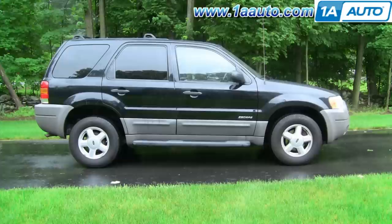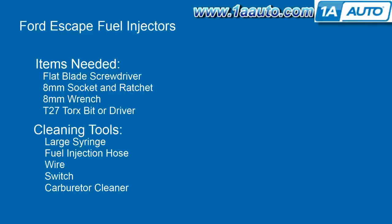Thanks. In this video, we're going to show you how to replace as well as clean the fuel injectors on this 2002 Ford Escape with the 2-liter 4-cylinder engine. And the items you'll need for this is a flat blade screwdriver, an 8mm socket and ratchet, an 8mm wrench, T27 Torx bit or driver, and if you're cleaning the fuel injectors, you're going to need a large syringe, fuel injection hose, some wire, a switch, and carburetor cleaner.